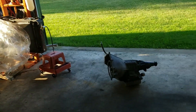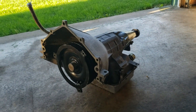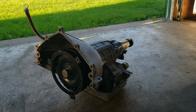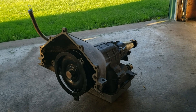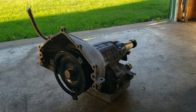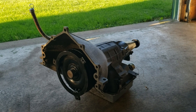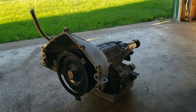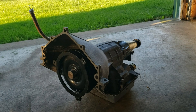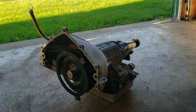The transmission I'm talking about is a Powerglide. It's got an 8-inch stall converter in it. The gear ratio is 1.82 to 1 final drive. I've got a trans brake in it. This converter is not designed for this engine — I'm hoping it'll stall at around 5,500 RPMs so I can get some more 60-foot time out of this car and hopefully pick up some ET. Let's throw it in and see how it goes.